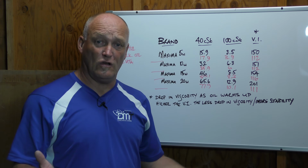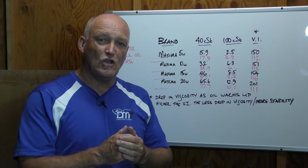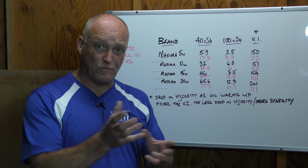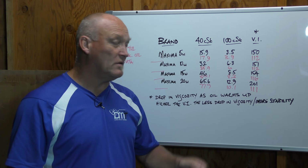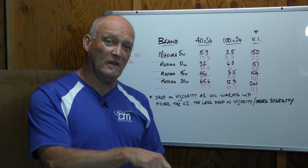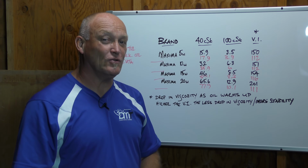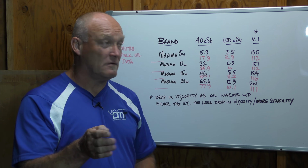And then the third is based on your level of use. If you're going to the track and then you're going to upgrade to a race bike, normally we take the stock internals away and we replace the internals completely with a cartridge kit. And all of the manufacturers provide that, where you take the stock stuff out, put their stuff in, and now we're at a race level. But again, when you get to track or race, the engineering you've purchased requires a set oil viscosity. Yes, I heard you screaming. But which one applies to you, your environment that you ride in, the pace that you have, which one's most appropriate?